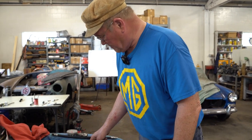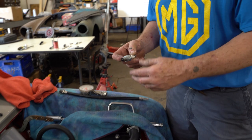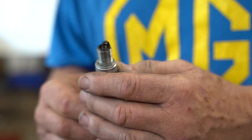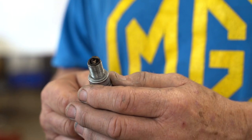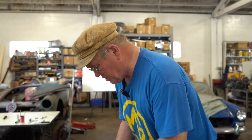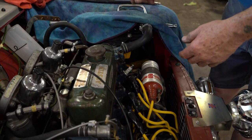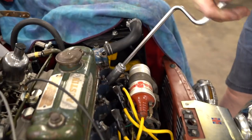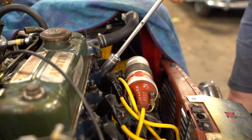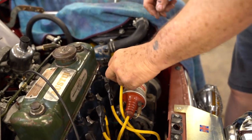So I did that, and then I made sure the plugs were all gapped at 35 thousandths. I know the workshop manual on the MGs at least says 25 thousandths, but my experience is that a gap of 35 thousandths fouls out less. And those of you who follow me know I'm no fan of platinum plugs, because once those foul out, they don't seem to want to clear themselves out again. So when you put these things back in, you're not using an impact wrench, you're just down to where it's snug and then just a little bit tighter. That's good enough.